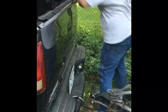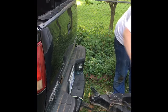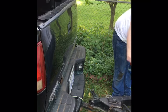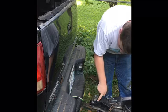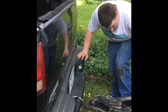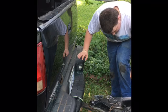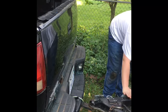I'll climb over the hitch here, and I'll start cranking the camper down onto the hitch. So here you go. You're just gonna crank it down right there. It's on the ball. You take this thing, you flip it over, and make sure you do that first. That's always a safety priority. Now you'll crank the jack all the way up. Make sure the wheel stays straight. Okay, so just about there, you lock that down. There's a pin, you pull that right up.